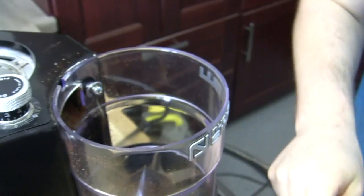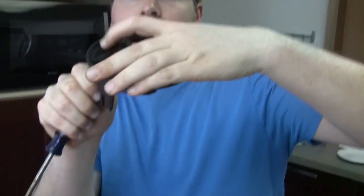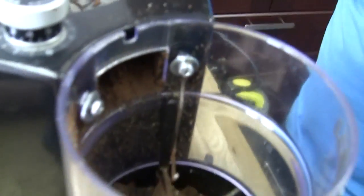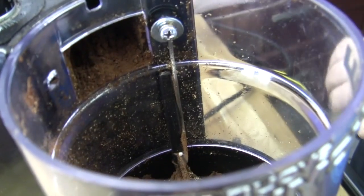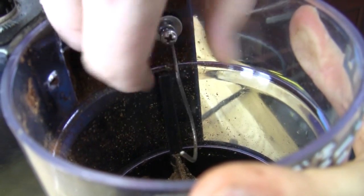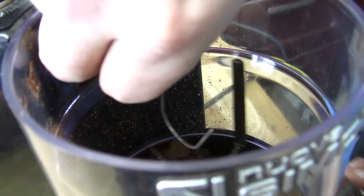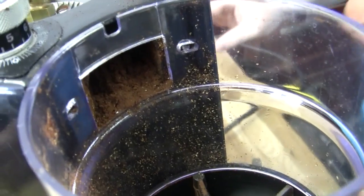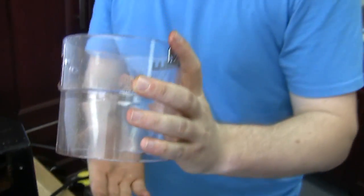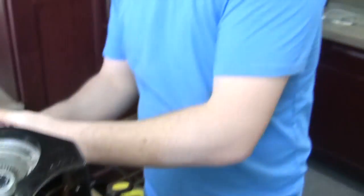This will come right off — because it's just in there to hold these on, not screwed through. This is a very, very easy grinder to get into. I'm going to go ahead and take both of these screws all the way out and not drop my washer. That little wire there is actually just to break the grinds up a little bit — as it spins, it sits right there and holds them level, basically a finger. Now I can actually just take this off. There's not a lot of grinders where it's this easy to do.